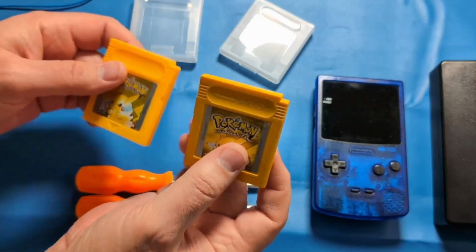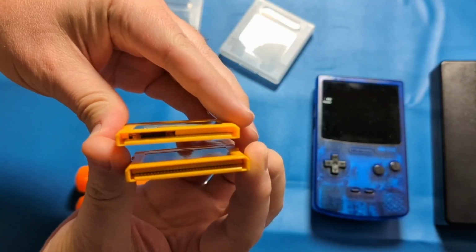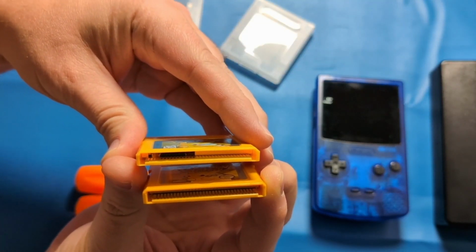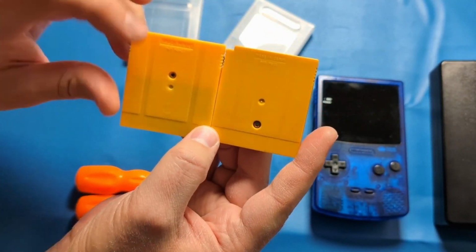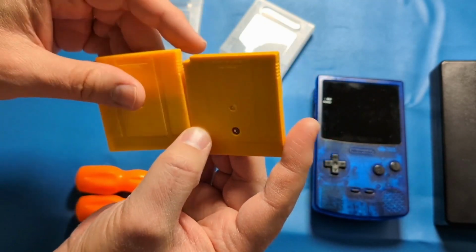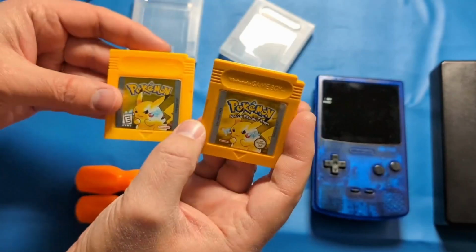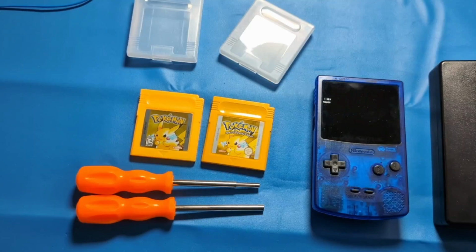So the main parts to check would be the opening for the case and the screw on the back. If it's a tri-wing and it's up there, then that is definitely a red flag. And then the board will have the battery and also those little 4 rectangles on the back. But everything else, whatever you play it in, plays the same as a legit one. So it's tough to tell other than actually looking at the circuit board on it.